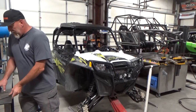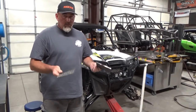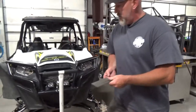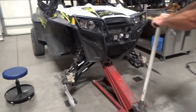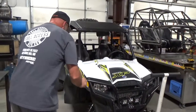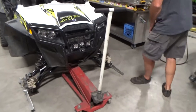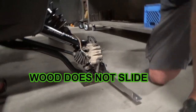We've got both plates set up. You're also going to need some steel plates — not included in the kit. These are just some old diamond plates we have, roughly equal in size; you can use almost anything, just don't use wood. You want to set them under the lowest point of the car. When you set it down on the ground, the suspension is going to travel out, and what you're doing with the steel plates is letting it glide and not get stuck to the concrete.